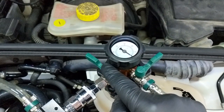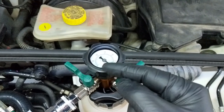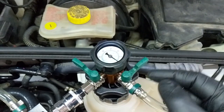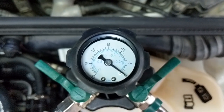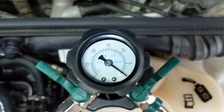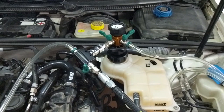We're ready to start. First I'll open the Venturi valve followed by the intermediary valve. That'll allow vacuum to begin building and we'll see the needle starting to move on the gauge. It'll take less than a minute for the vacuum to stabilize at a maximum negative pressure, and even at that point I'll continue drawing vacuum for another 30 seconds to make sure all the air is out. When the needle has stopped, I will close these two valves again. This gauge reads in inches of mercury vacuum — that's INHG. On a typical passenger vehicle, the maximum negative pressure you can achieve is somewhere in the negative 15 to negative 27 range, so don't be concerned if you can't hit minus 30.